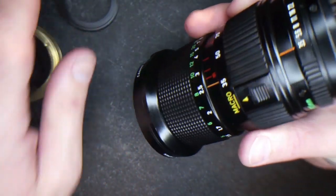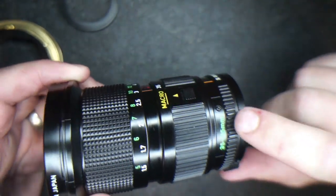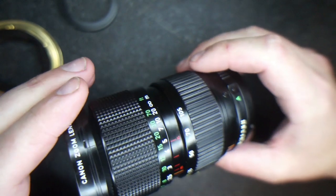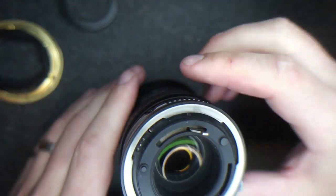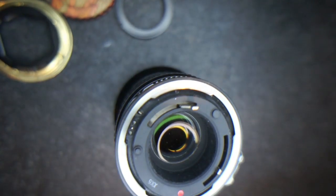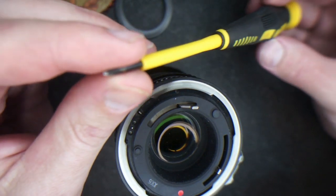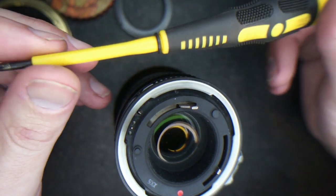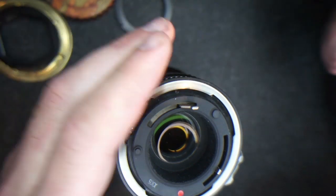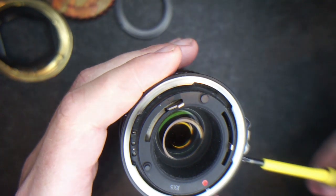Take your lens — this only works on the 35-105mm F3.5 FDN mount — and I'll show you how to put the kit on and convert it to EOS. You need a nice high-quality Phillips screwdriver, size 0. You could probably work with size 00, but 0 is better. Let's take this one apart.